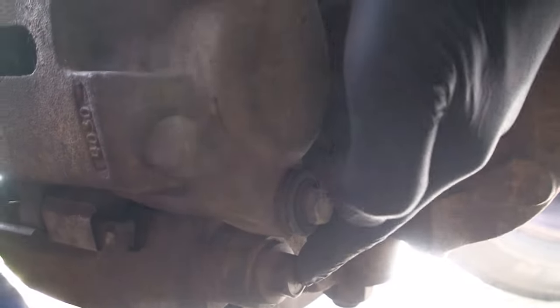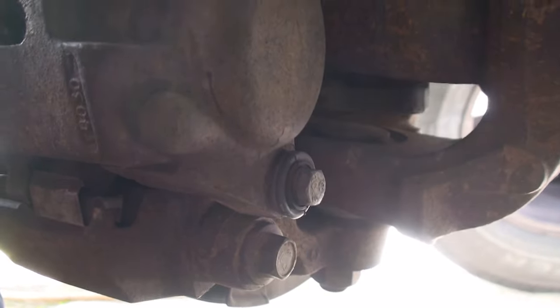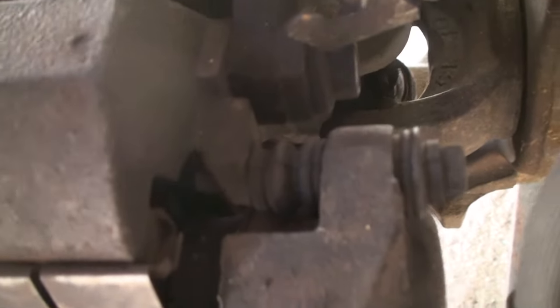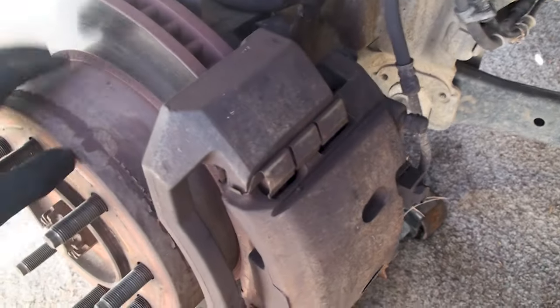On the back here there are two bolts that hold the brake caliper on, and then there's a lower bolt here. There's one here — so there are two: this one holds the caliper, this one holds the caliper mount. On top, this one is for the caliper and this one down here is for the caliper mount. We're going to pull both of those off, then we can remove this entire assembly and take the rotor off.